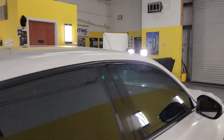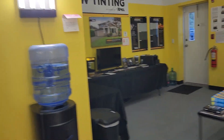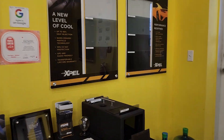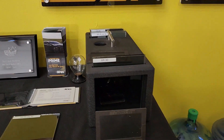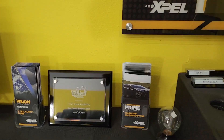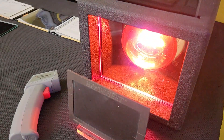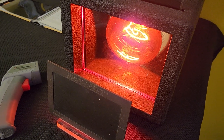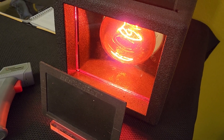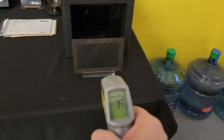Let's go back to the heat lamp and see what the XR Plus 30 does on the count of 10, and then we're going to throw the CES on there. Let's see what the heat sheet is reading before we do anything — 76.5, that's about room temperature. Alright, let's do the Plus 30 count of 10. Remember, the more heat this heat sheet feels, the more colors it's going to change. 1, 2, 3, 4, 5, 6, 7, 8, 9, 10. Notice it did not change any colors, and we are at 79.5. So yes, it definitely makes a difference.